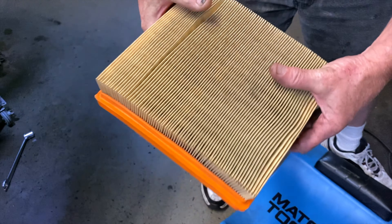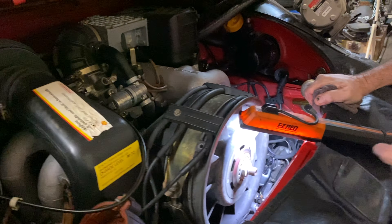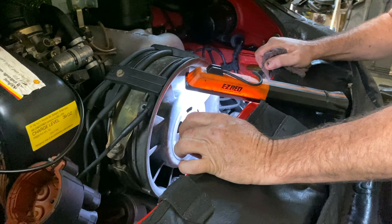So we're going to go ahead and put a new air filter in it. On the compression — I ran it twice before I wrote the numbers down. Number three is the only one that's off, but you're still within 10%. You might have a little bit of a tight valve — a loose valve is better than a tight one because the tight valve is not going to close all the way. So overall the engine is healthy. You've got 80,000 to 90,000 miles on it, so you're going to be looking at adjusting the valves since they're due every 15,000 miles. Overall opinion is that it's pretty clean and everything's looking good.